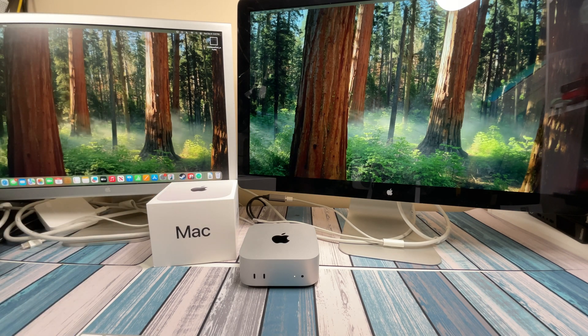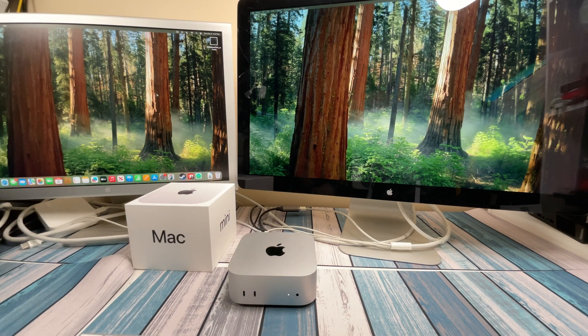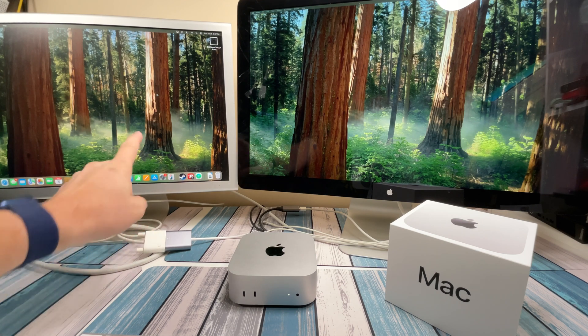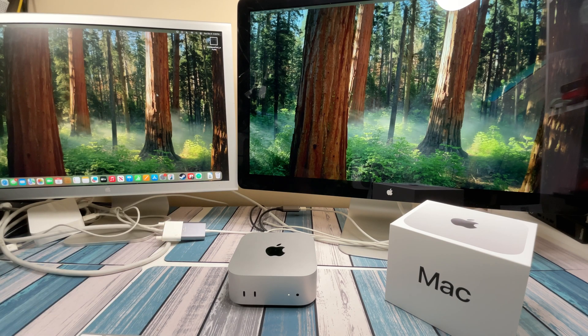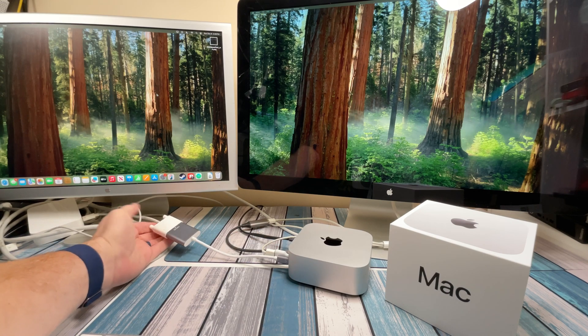We're going to start off here on the left with the 23-inch Apple Cinema display. I've got a bunch of cables underneath here — I didn't tidy them up because we're going to be breaking them out and looking at everything needed to make this work. On this particular model, it comes out with a DVI connector. They call this the DVI model of the monitor, because older versions had different connections like the old Apple Display connector. If you've got a DVI connector, that makes it easy. All I've got here is just a USB-C to DVI adapter. I'll have links to all these down in the description. They're not very expensive — you can grab them off Amazon. You plug it in, it just works.